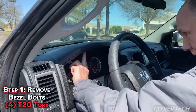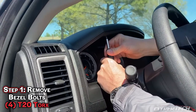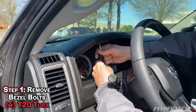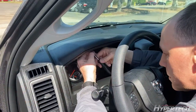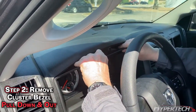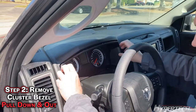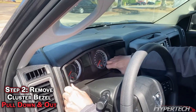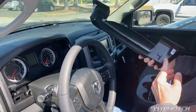There are four bolts here, here, here, and there that hold in the cowl over the speedometer. All the bolts are the same size. Pull down on the top, pull out, and lower your steering wheel. There are two clips on the bottom, and then it's just a matter of pulling it off — clips on the very bottom.